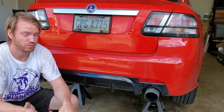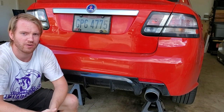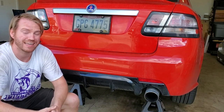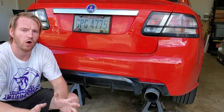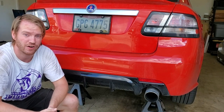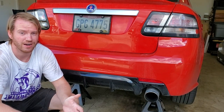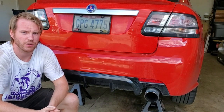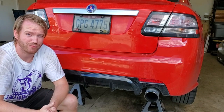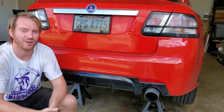When I first got this car three years ago, the fuel gauge would bounce all over the place or just wouldn't work. I did drop the fuel tank — no video on that — just to replace the fuel level sender. Now three years later I'm getting that P0089 code, and I think the fuel pump is up for replacement. Today I'm going to replace it and take you along for the journey.